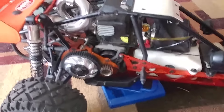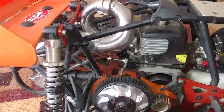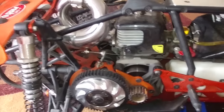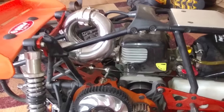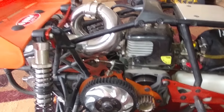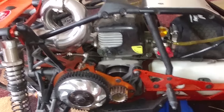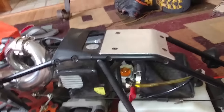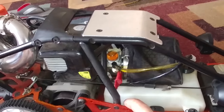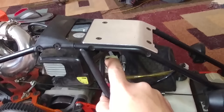If you're going to go completely off-road, these are not the tires I would use — I'd use more like Pioneers from King Motors, which are basically trenchers, or Hostile tires with huge lugs. Here you have your choke lever — in that position you start it and try to get it going, then when you're ready to run you pull it back up. And you've got your primer bulb.